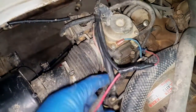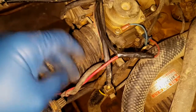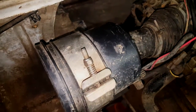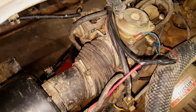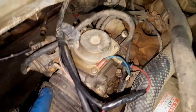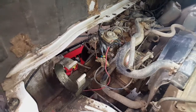What I'm going to do is label some of these cables — like this one that goes to the electric fuel pump — things that were rigged in a sense. After I get this out I'll return to the video. It shouldn't be a hard process — straightforward, three bolts and a little play and it should come right out. That way we get better access to the carburetor. I need to order a carb repair kit to replace some components. I'll come back to the video after I take that out.